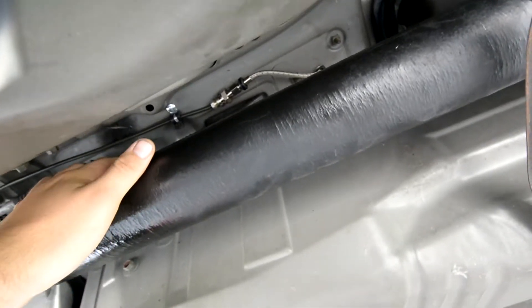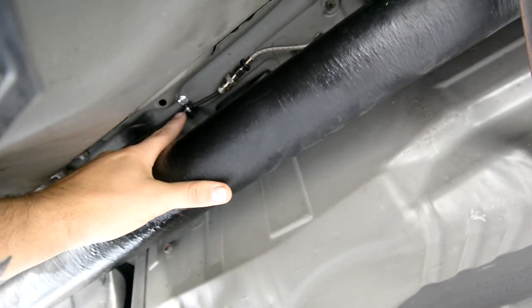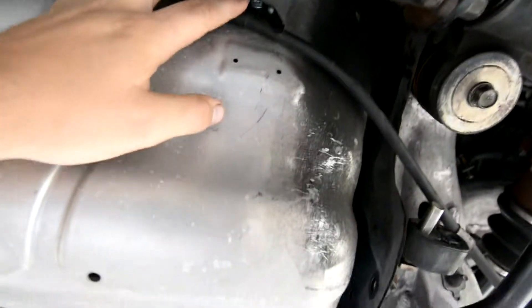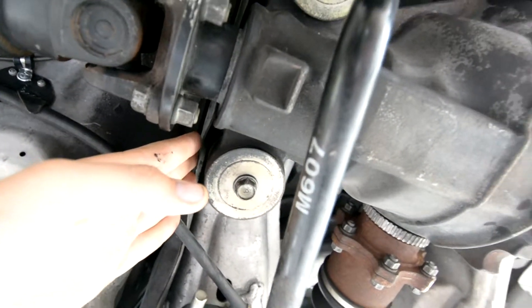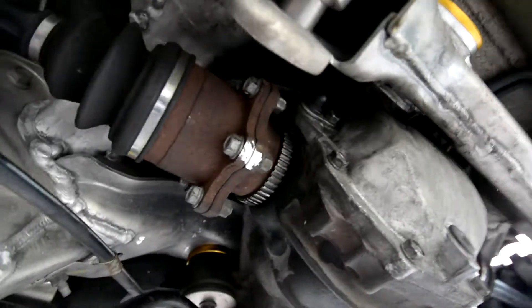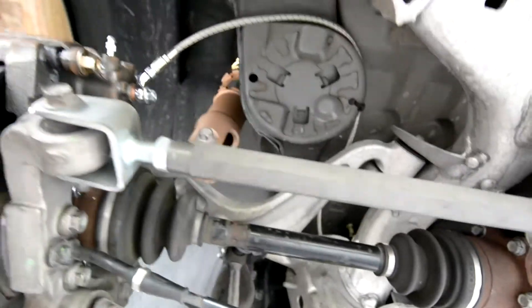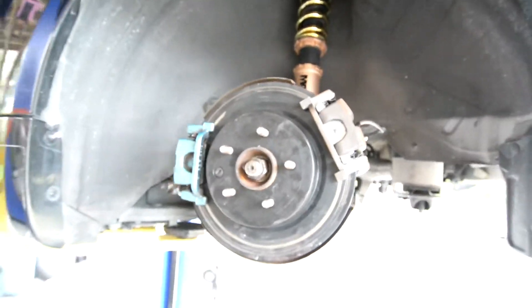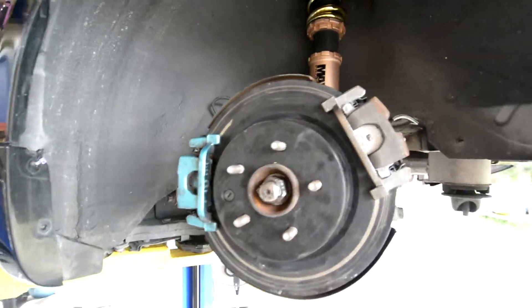I ran the hard line from there, mounting it down with three clips. Clip one is right here, brought it the whole way over to clip two into this bracket. Then it goes up and over the subframe — you can't see that part because it's right above the differential. It splits off at a T-fitting and goes around onto the dual calipers right here. That's the brake line.